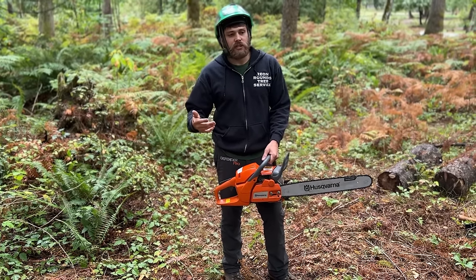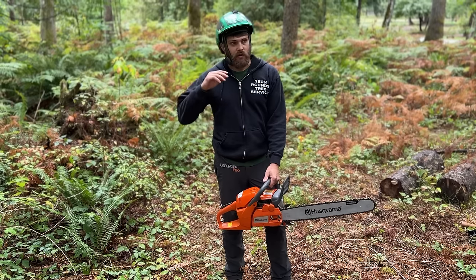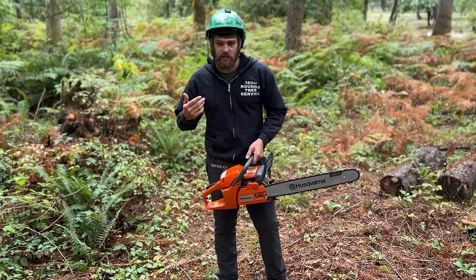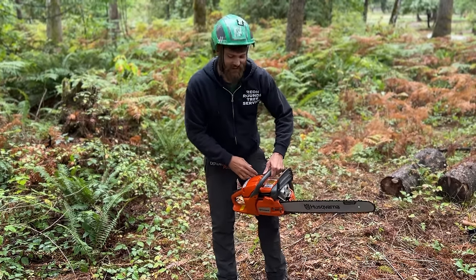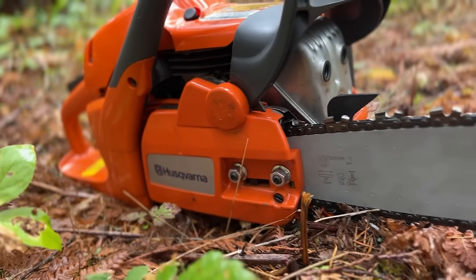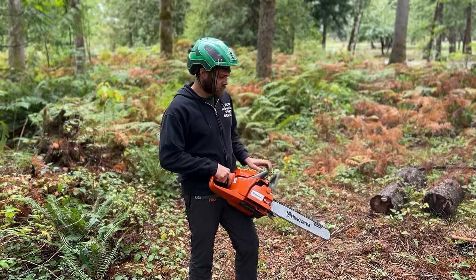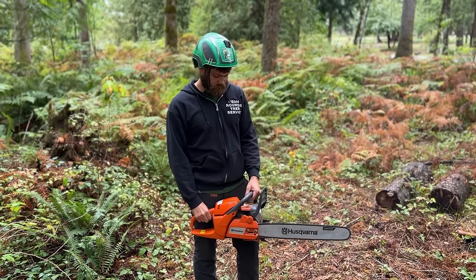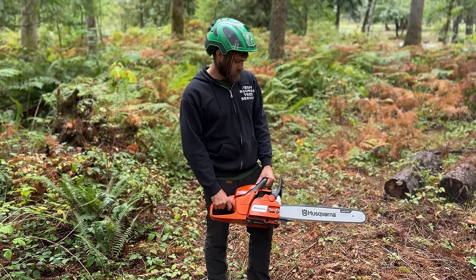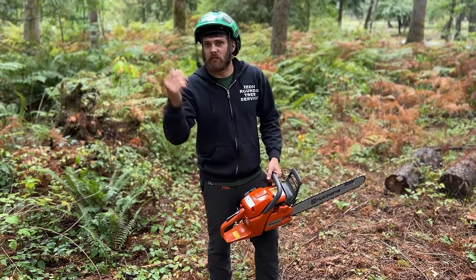I really don't do any break-in method. I just let it idle for about a minute, like I normally would, and then I just go about working. I've had a lot of saws, and I've tried breaking them in every way imaginable. Once again, I'm going to drop start it, just because that is the way I do it, especially with these short bars. But I'll do it the textbook way here. I guess it's not so bad. So the saw is warm, it's broken in for the most part, I think.